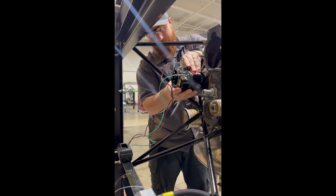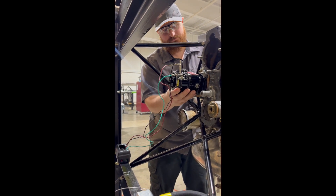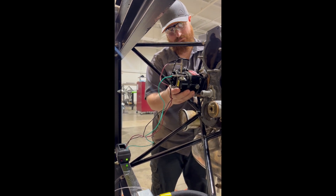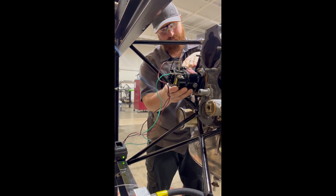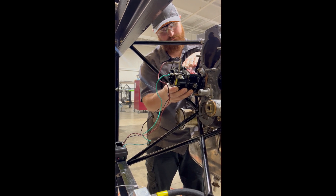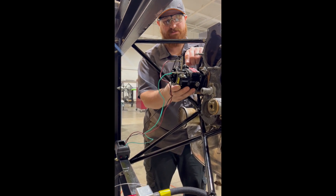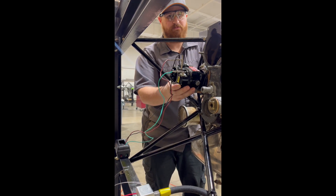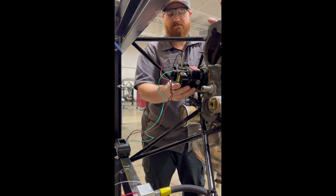So now we're going to rotate our magneto — rotate the prop. So right there, the buzzer is going off. That is telling me that this is properly set at the correct timing point according to where the 24 degrees that the propeller is set to and where the magneto is stopping the buzzing — this is correctly timed.